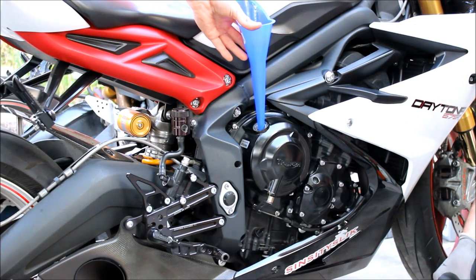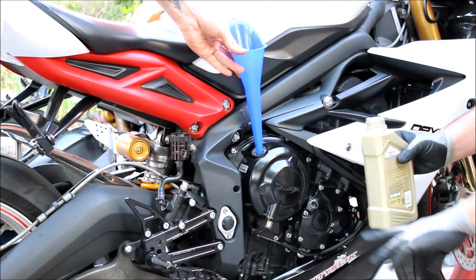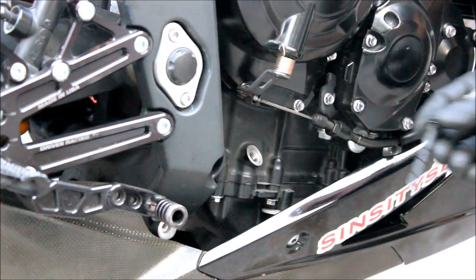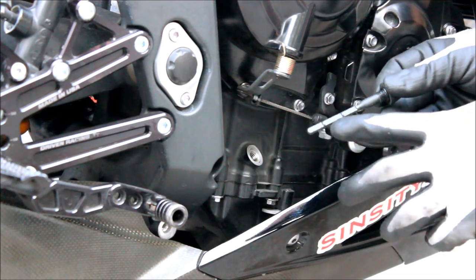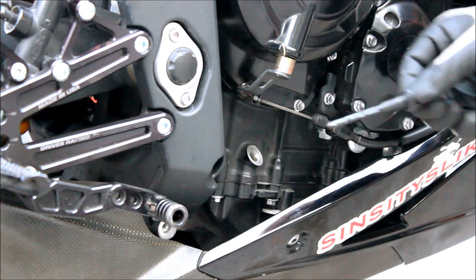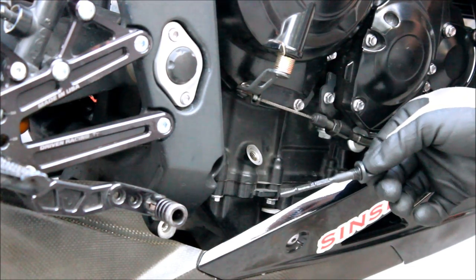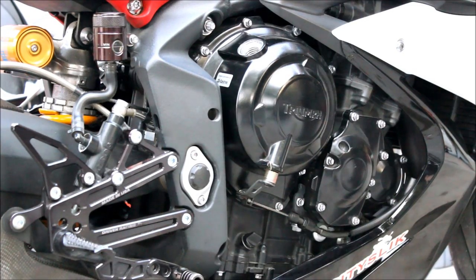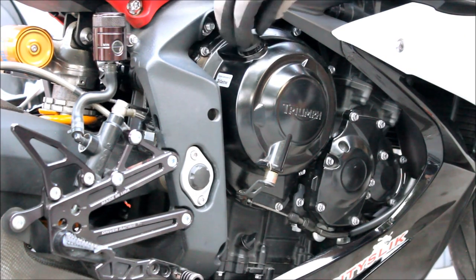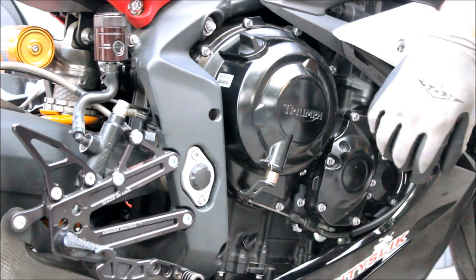The capacity of this bike is roughly 3.4 quarts, somewhere around there. So we should be able to add about 2.5 to 3 quarts before seeing anything on the stick. Go ahead and start adding oil. Most motorcycles that have dipsticks like this — in order for you to check the level, you actually don't screw it all the way in the majority of the time. So you're actually going to stick this in until it stops and then pull it right back out. And if you can see, we're right about the middle. So now we're going to run the bike, and that's going to fill the oil filter with oil, and then we're going to check our level again. Be sure that before you run the bike, you put the drain plug back in and also put the oil fill cap back on. You don't have to put it on tight, just hold it still — if it runs and this is open, you can start spitting oil out. So let's run the bike.